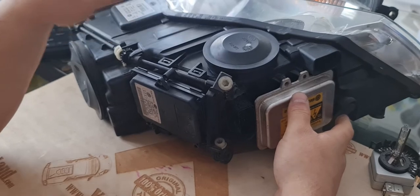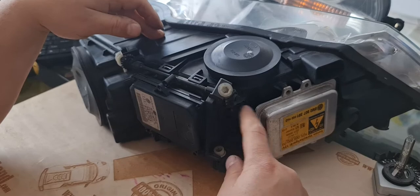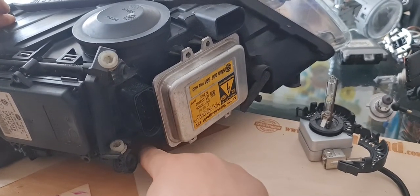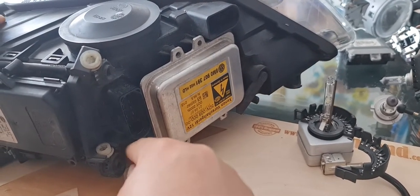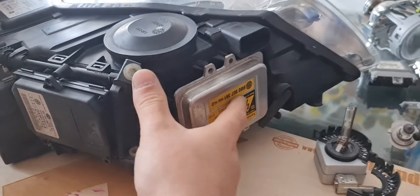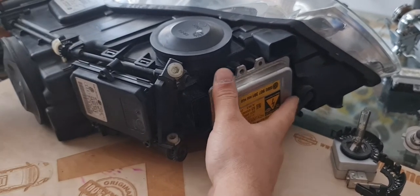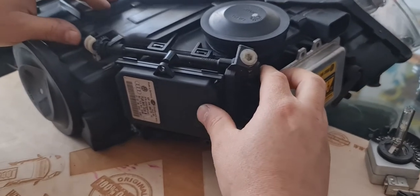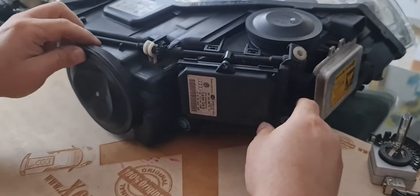There are a lot of videos on YouTube showing how to remove your headlight from your car. It's a very easy operation — you just have to remove your headlight plug, and there is a locking mechanism right here, a white plastic strip locking mechanism. Just release it and the headlight will pop out. You can take it for a bulb or ballast replacement. It's one of the most practical headlights made in the whole xenon industry.